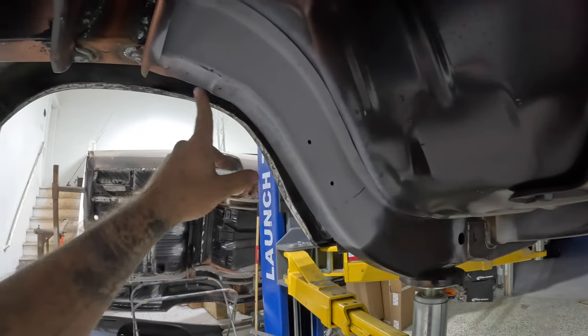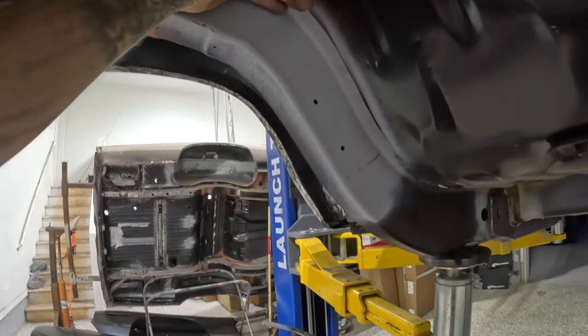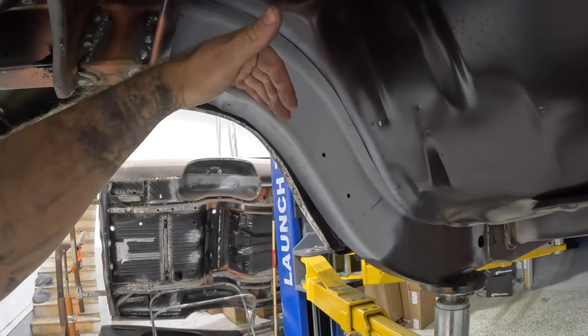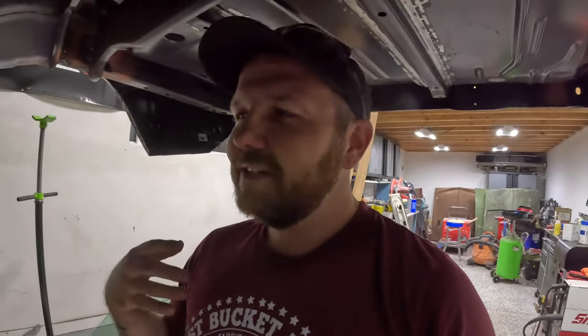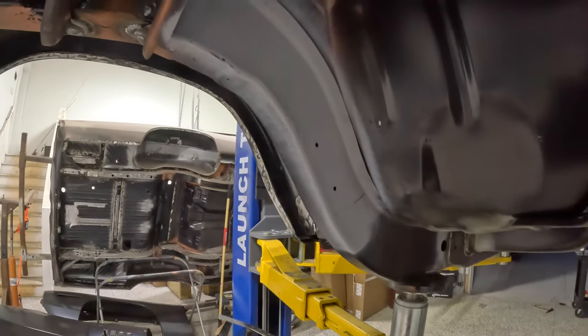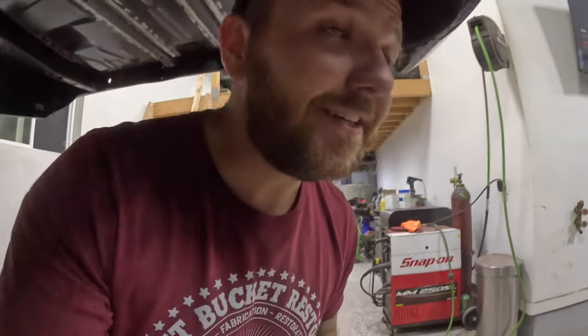We're gonna make sure that the V's are over the holes, and then also the instructions say to basically make it fit as low as possible, and then also to make sure that your strut mounts are straight up and down. So a little bit of finagling, just make sure that the V notches are lined up, and again, that it's as low as possible, and make sure it's center. Take a look at it from side to side, take some measurements, do whatever you need to do, and burn it in. So this should be the last of the welding for this episode.